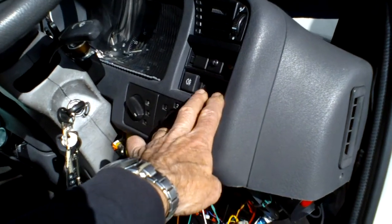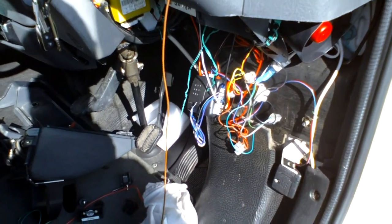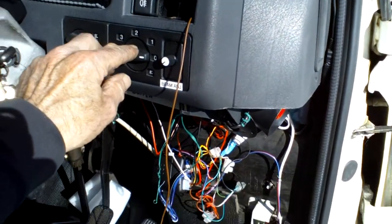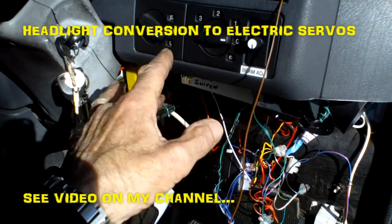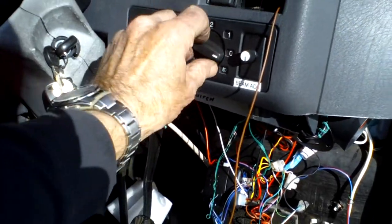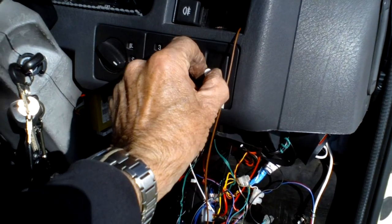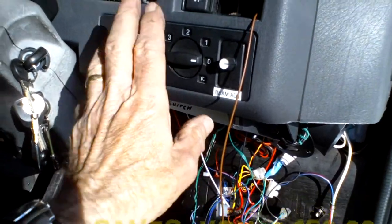Now I've got the horrible job of getting wire from the relay box all the way through the bulkhead to the dash, and that is a pain. Under the dash, I've pulled the wire through and managed to get it through on the old system there. I put the electronic headlamp levelling unit in there - which works the servos on the headlamps - those things are 160 quid on eBay and they fail, so I've kept it there. But the pipes that go from there to the back of the headlamps, I'm using as a way to route this wiring.